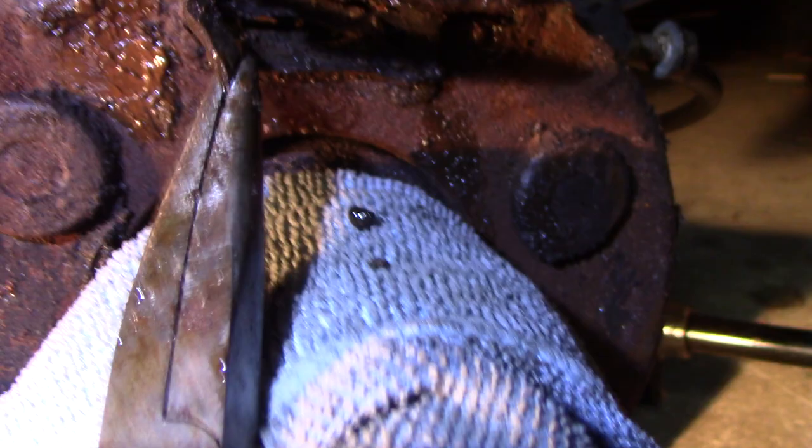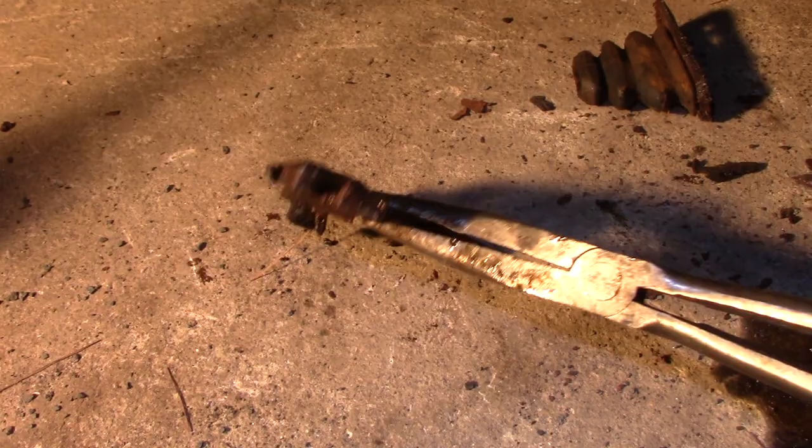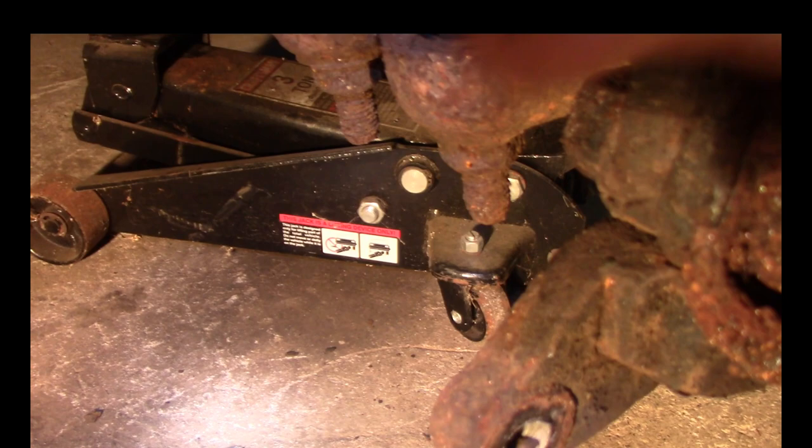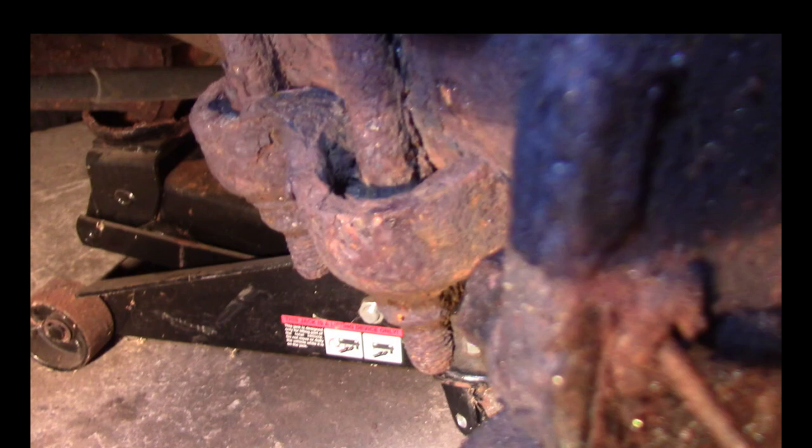It does look like the boot comes out this way. I've got all new stuff coming. Because there's no shield on here, it's just got a buildup on this. The reason it's wet is I tried to lube it up and free it. Just wasn't having it. Now there's already a problem — this is a 24mm socket and it ain't going to go in because the spring shackle's in the way, of course.